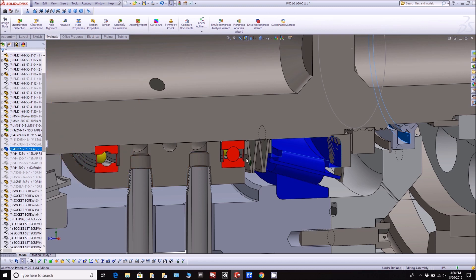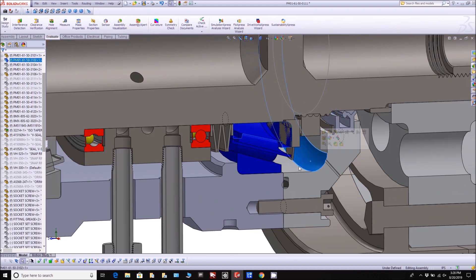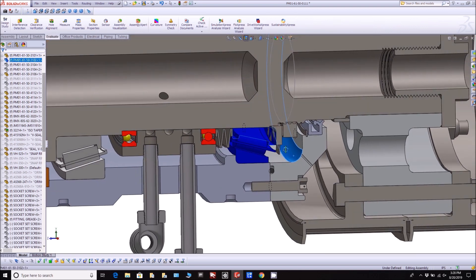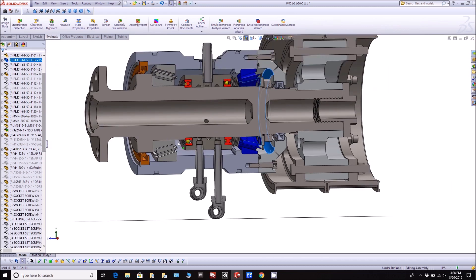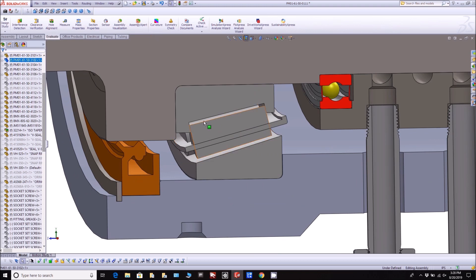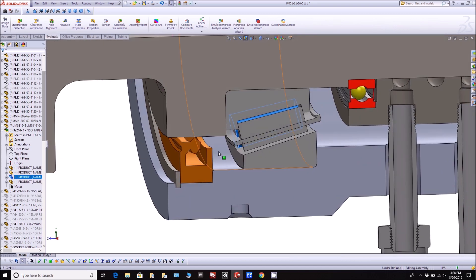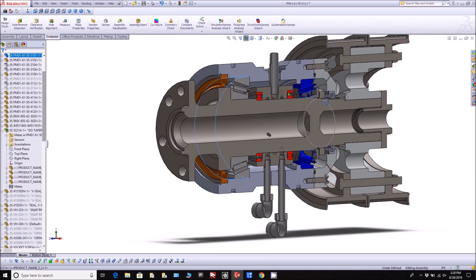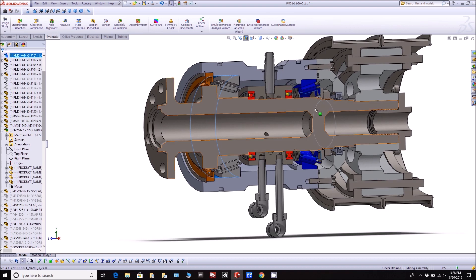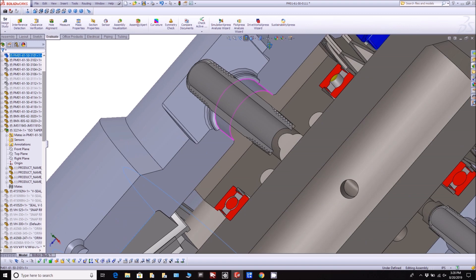Those small bearings are fine, everything else is fine, the washers are fine. That area down the back will have oil in it, and once the oil starts slinging around at full power it'll get refreshed on either end. So we're basically running a full oil bath without using the 60 psi feed from the engine, with just a single drain — a brand new drain line going back to the sump — not teeing in with the other one and running everything down through one smaller setup.